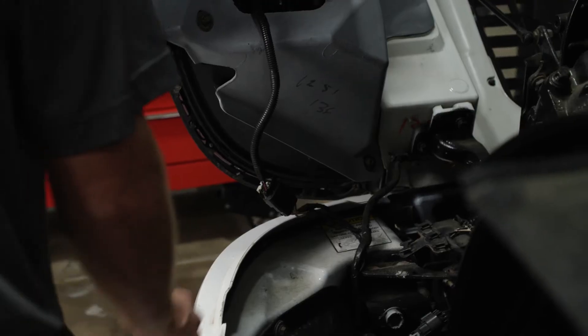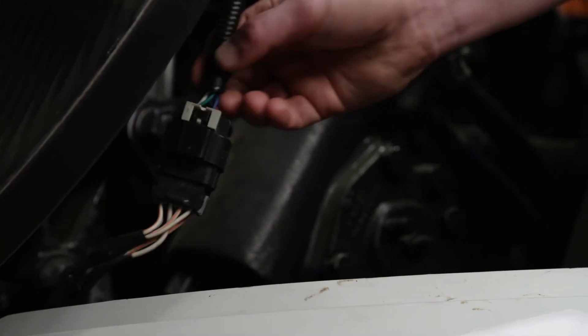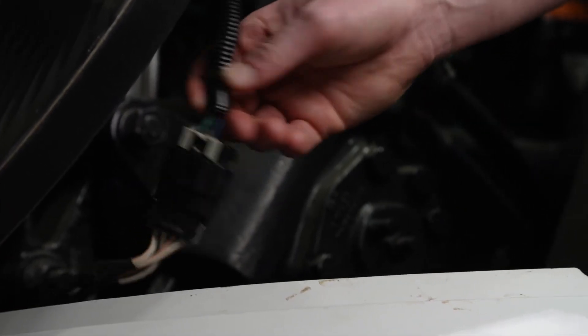One of the first ways to check for damage to a wiring harness is to perform a wiggle test using a diagnostic tool like JPRO. A wiggle test will help to identify the location of an electrical issue. It allows users to monitor variations in data while physically wiggling a wire, plug, sensor, or other electrical component.